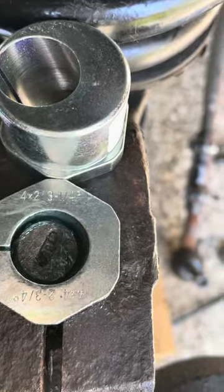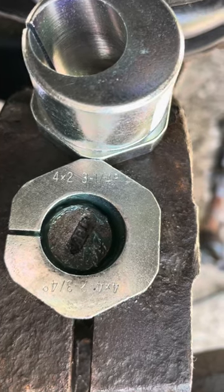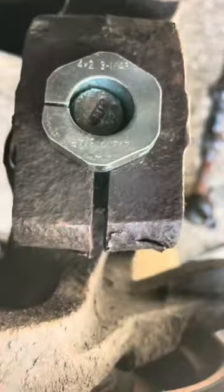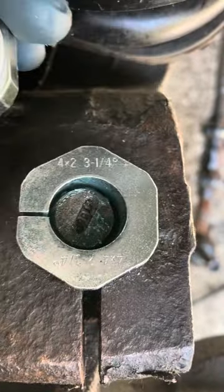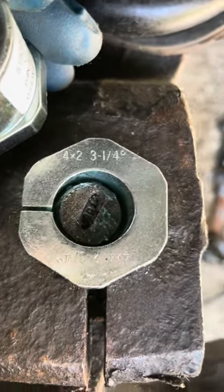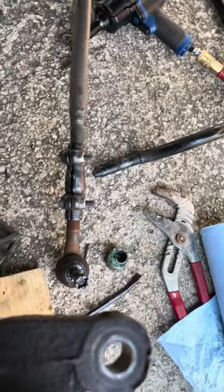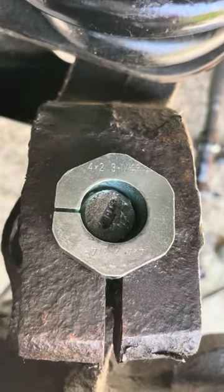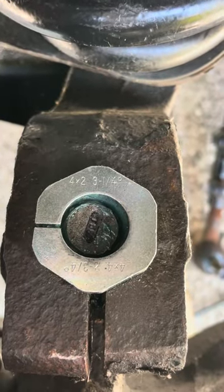How this will work out as far as camber goes I don't know, but I'm going to take it to an alignment shop. They charge a fortune just to put these things in, but it's a pretty simple process. You take out one bolt — a pinch bolt that goes right in here — then wiggle the knuckle and get this to go down in there with a hammer. I also took off the tie rod and the sway bar to have maximum ability to move things around without forcing it and potentially damaging the ball joint.